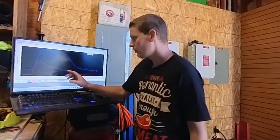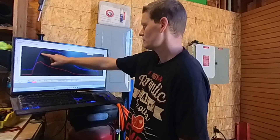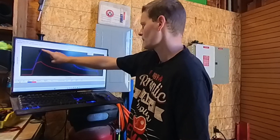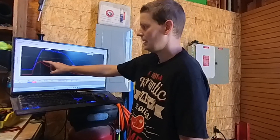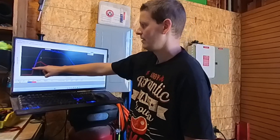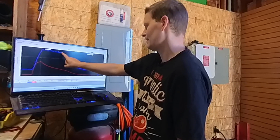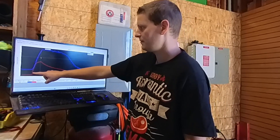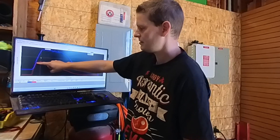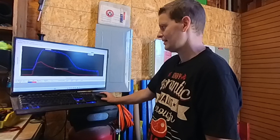Here's the full run. The blue line is the watts or horsepower — it ramped up really fast right to the max near the beginning and stayed pretty steady. This is kind of the same curve I've seen on other bikes I've tested, except that it ramped up power very, very quickly. Then you can see as the RPM gets towards the higher end, the power starts to drop off and eventually fades into nothing as it reaches the max. The torque ramped up very quickly too — kind of interesting that it ramped up fast, slowed down a hair, then hit its peak — so really good acceleration — and then the torque faded off pretty gradually from there on out.